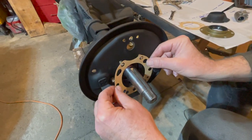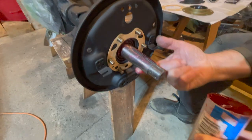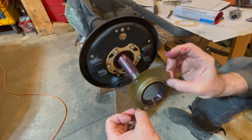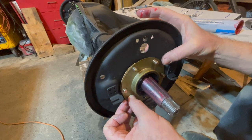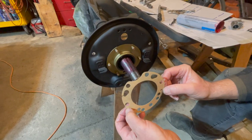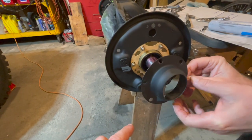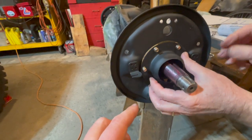Now install your first gasket, making sure the holes are lined up and the drain hole is at the very bottom. Make sure to apply some grease to the axle shaft. With the first gasket pushed all the way onto the bolts, now we have to install the oil seal — make sure you add some grease to the inside where the rubber is. Install the oil seal onto those bolts going right through the brake backing plate, with the larger lip facing outwards. Finally, install the last gasket on top of the oil seal, and then install the grease retainer on top, lining up the holes with the drain hole at the bottom.